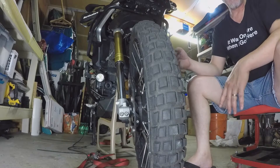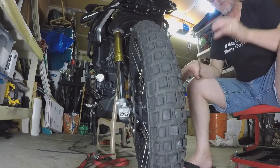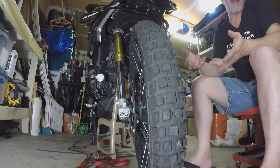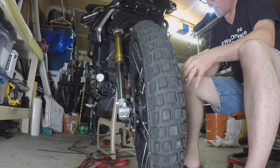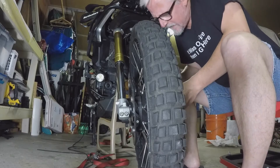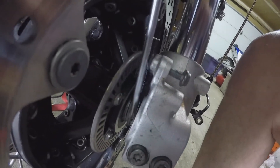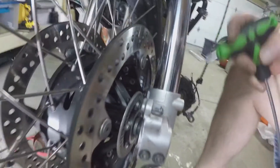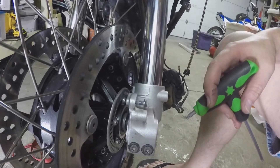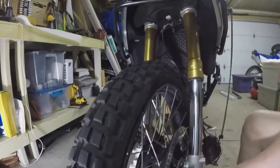The rotors are being bolted in and they're not seated yet, so everything is kind of on the move - and that's not great for a brake system. You do want to make sure you give some allowance for a little bit of movement. This ring has come out, so I'm just going to seat it back in there. You can see this is terribly not in alignment, probably because the other fork is rotated a bunch and this fork may not be rotated enough.